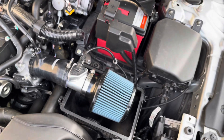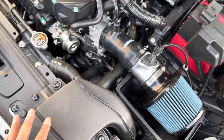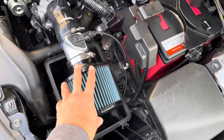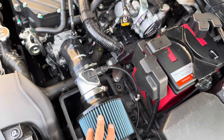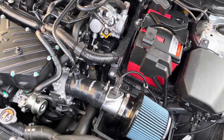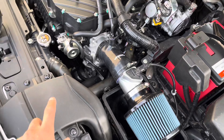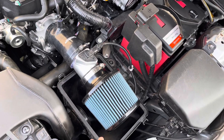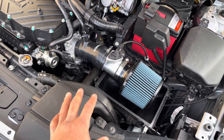Another reason I feel this is the best setup: I don't have the extra resonator stuff on this snorkel, so majority of my air is just being forced and tunneled in to feed the supercharger. If I had a lid on here I could force more air, but I don't want to force more air when cruising because more air means more fuel and lower fuel economy. That's a reason I don't like the Takeda intake. My setup is pretty simple: turbo snorkel, Injen inertia filter, AutoX hose, and a generic MAF, still connected to the bottom of the stock box. This whole setup cost me $155.